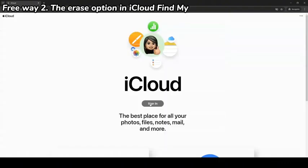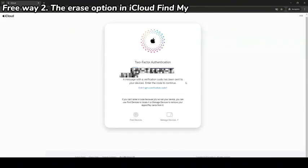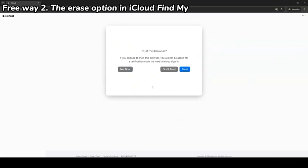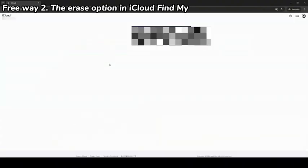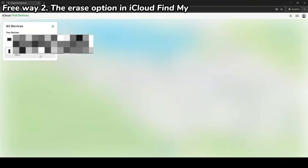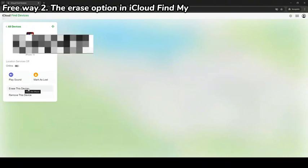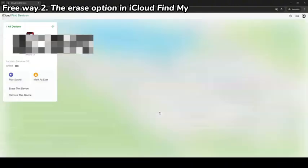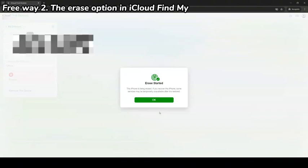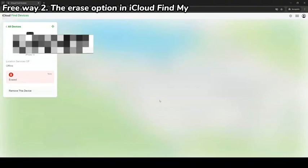Open any browser and go to iCloud.com. In the login menu, enter your iPhone XR's Apple ID and password. Once logged in and iCloud's homepage appears, find and choose the Find My option. It'll show you the devices linked to the logged-in Apple ID. If you can't find iPhone XR from there, double check if the Apple ID account is correct. If you see iPhone XR, select it. Next, choose Erase this device to unlock the iPhone XR forgotten passcode for free. It'll prompt you with a dialog box letting you confirm deleting everything on the phone. Choose the Erase option and finish the following on-screen instructions until the erase is started.